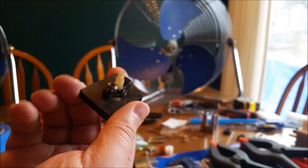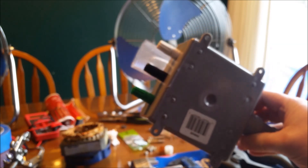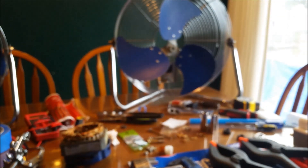The switch was also pretty mangled up. It looks like the knob fell off and the owner had been turning the switch with pliers. So I hooked the loose wire ends up to my tester that I built — it's got plugs that you can screw the wire around to. It did work, but the bearings were dry and it was intermittently singing the song of their people. At that point I moved the good switch and the cord over from the first unit to this one. What I found interesting is the older unit originally just had a two-prong cord despite the fan's all-metal construction, but the older frame actually still had the provision for the ground.